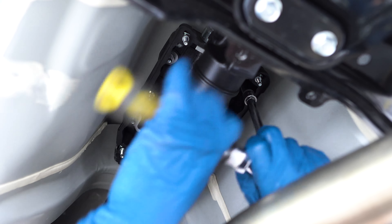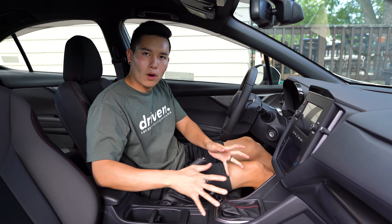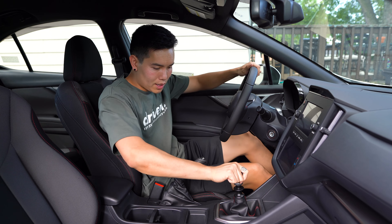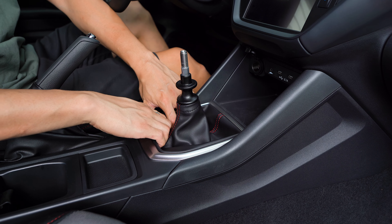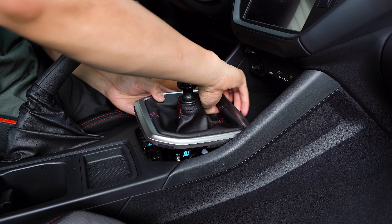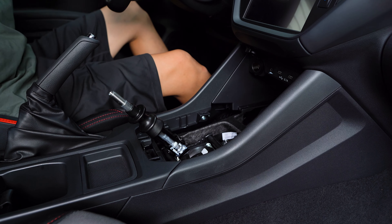Now we can go inside the car. Hopping inside, our shifter is now even more sloppy. We are going to tear apart the center console a little bit. We'll start by unscrewing the shift knob. We're going to remove the shifter trim along with the shift boot and the bottom tray of the cubby hole — it's all one piece. All you have to do is reach in here and find the edge of the shifter trim with your fingers and pull straight up, and that should pop it out of place. We'll just slide it off of the shifter like so.